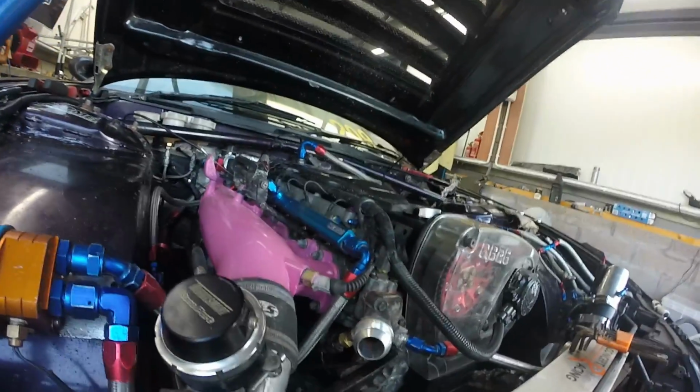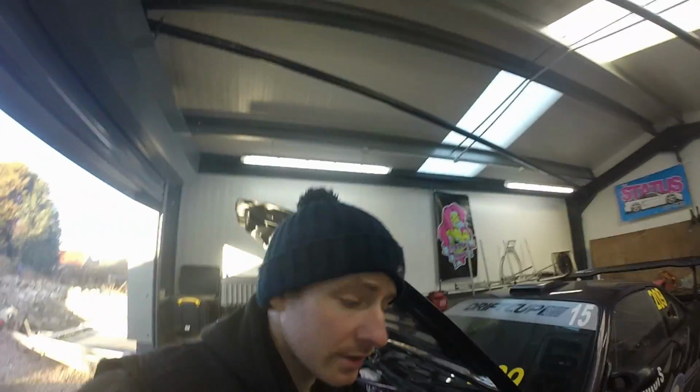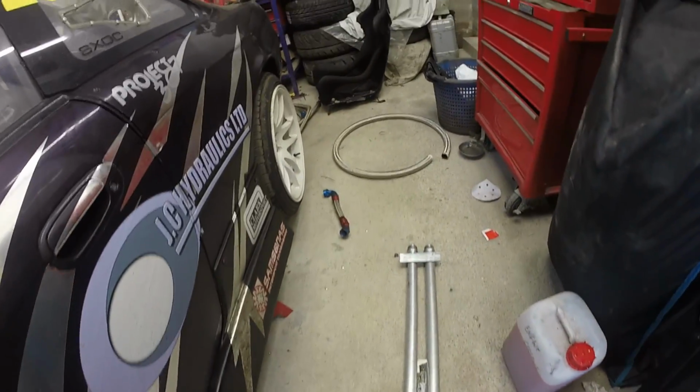Dash 20 fittings, and I've put the sensors into the actual housing up here, so it's a better representation of the sensor. Representation of the sensor? Is that the right thing to say? Oh, God knows. Dash 20 water pipes for going underneath the car. I just decided to swap up to Dash 20 to get better water flow through the system. James Dean's still using Dash 16, I think, which is more than good enough, but I noticed some of the Formula D guys are using Dash 20, and I just thought it'd be better upgrading while I'm rebuilding the cooling system.